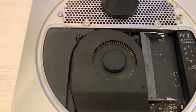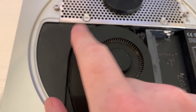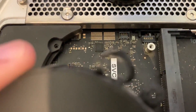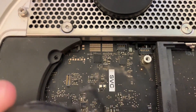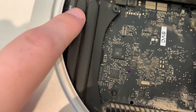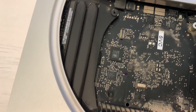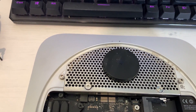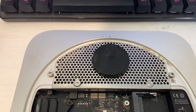RAM is out. To remove the fan we have three screws — one, two, and three. We use a T6 Torx screw and remove the cable right over here. We had a plate over the CPU heatsink with a single screw — that's the fan screw — and another screw connected to it. We remove that, and now we remove the antenna.